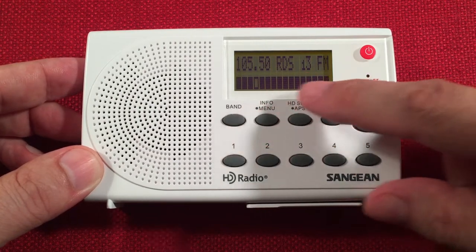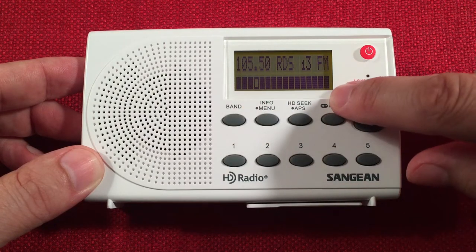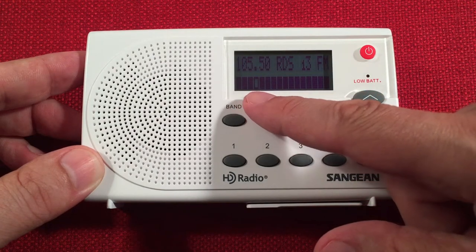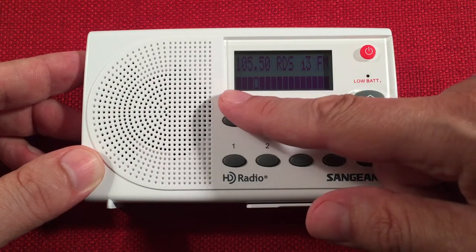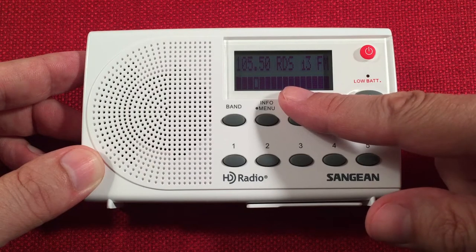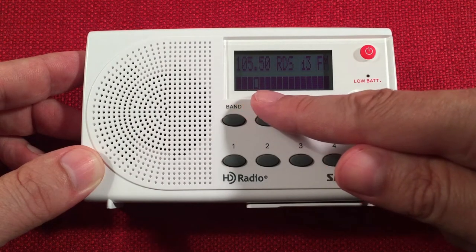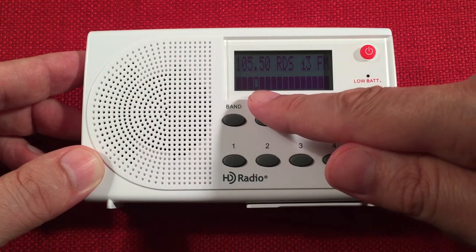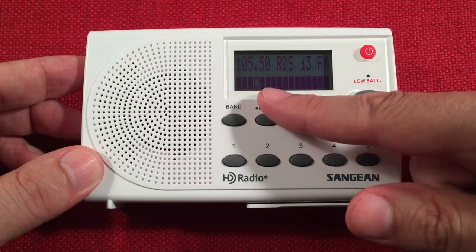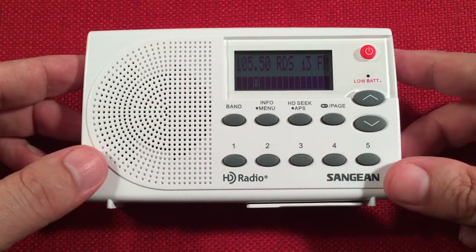Of course, that mono will change to stereo when you're using headphones. Now, here's your signal strength indicator. This is a local station. It's pegged. That little spot right there is a threshold, and that's for HD. So first of all, it'll have to be past that for normal reception. And then when it detects it has decent reception, it'll start to go for the HD signal. Then you'll see it drop down, and it'll start going back and forth. And if it can stay above that threshold marker for HD, those HD stations will stay locked in. If that HD signal drops, then it's like losing a satellite connection. It just drops and you're waiting for it to reconnect.